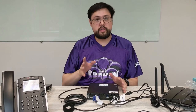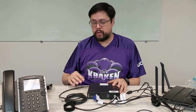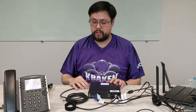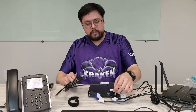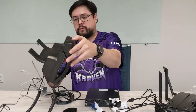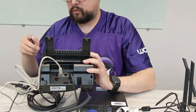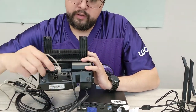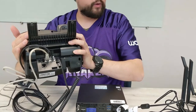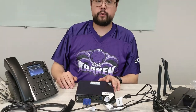We have the desktop computer connected to your keyboard, mouse, and monitor. We have your phone plugged into the power over ethernet injector going to your home router. We need to get the phone's internet and cabling connected to the desktop so that you have a pass-through internet connection. Take the ethernet cable connected to the back of your computer, grab your phone, flip it over, and plug it into the ethernet port right next to the cable used for the injector — the one that looks like a little tiny computer setup. That will give you a connection to the internet from your home network, and that completes all the cabling and wiring for your home network.